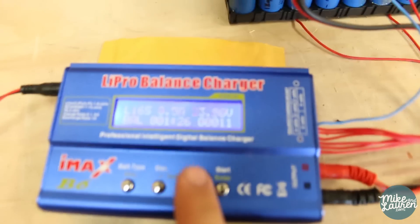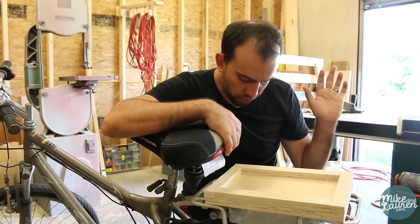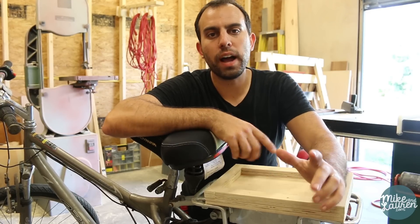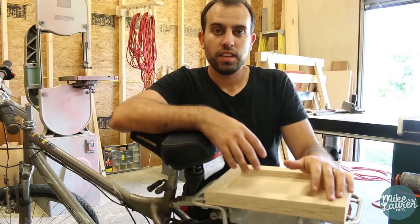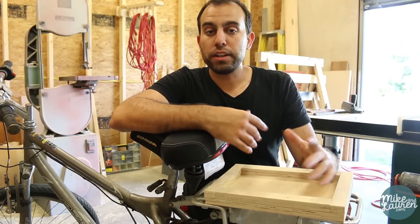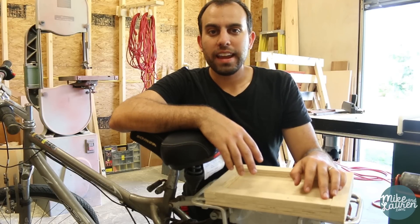Now we wait and let it charge for a while. We're currently at 23.8 volts. Once it's fully charged I'll discharge it so we can see the total capacity of the whole battery, then charge it up again and we'll be done. I was going to do a big makeover on this bike, but it's such a piece of junk I'm not going to bother. I have a 1971 Schwinn at home I'll use for the next build. I'll ride around on this at work for a month or two to make sure the battery lasts before investing in a second one. When I do part two — converting the Schwinn and building another battery bank — I'll address questions from the comments for a complete A-to-B guide: laptop batteries into DIY electric bike.